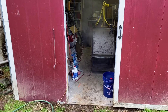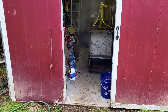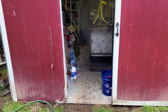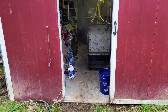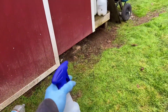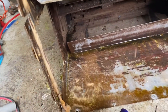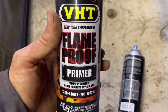The thing is, once the acid is removed, the steel will immediately start to rust. So you take this off, use baking soda and water to neutralize it, rinse with water, sand it, rinse again, dry it out, then get it painted fast. I'm going to dry it out with a torch once everything is neutralized. You definitely want to neutralize this stuff.